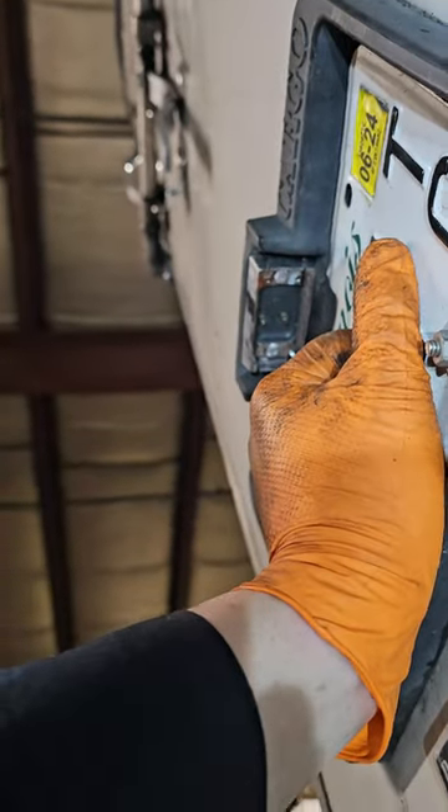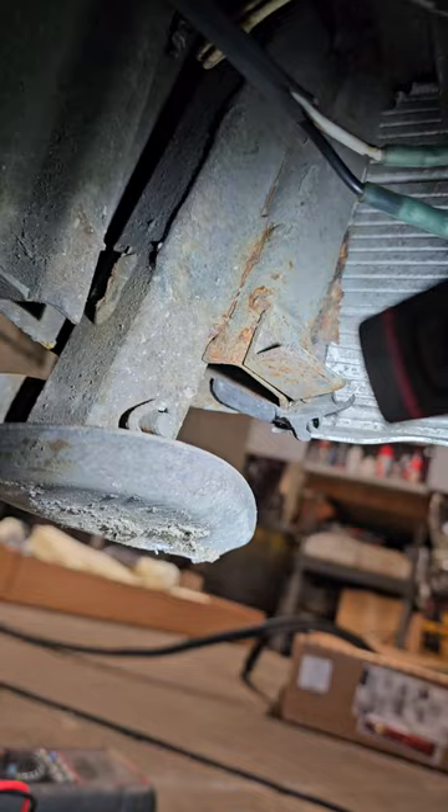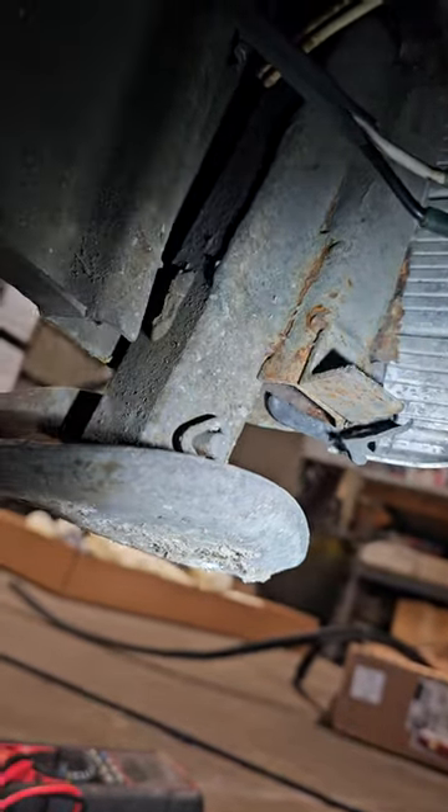I have a trailer that the plate light stopped working on, so I took the meter to it. I've got zero volts coming out of that. I followed the harness down, shined my light up there, and what happened was that the stand got caught on a curb and got pulled backwards, pinching the wires for the plate light.